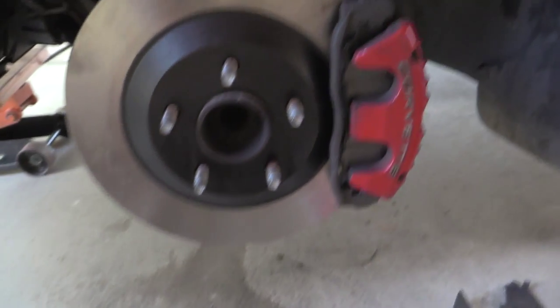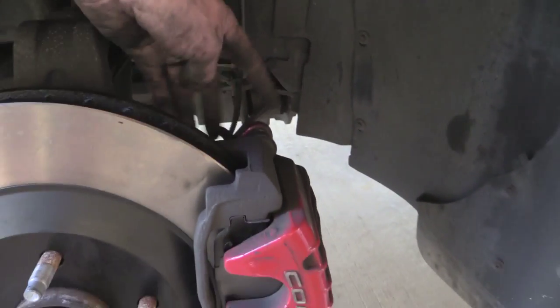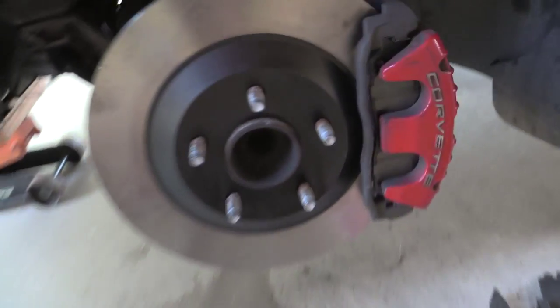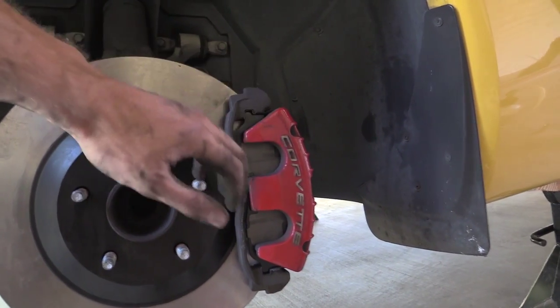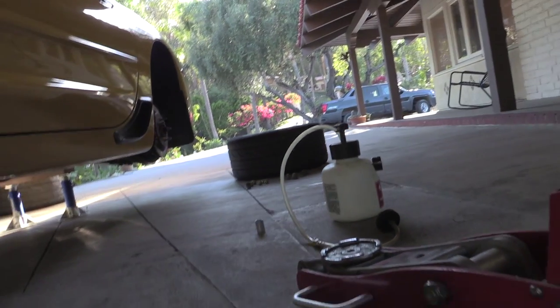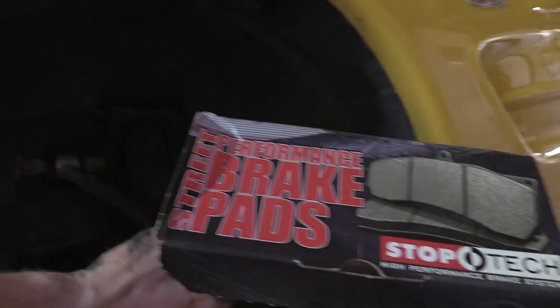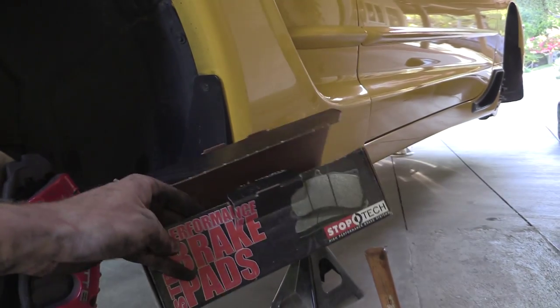So this is everything back together on the front brake caliper. This torque specification is 23 foot-pounds — that bracket was 125 foot-pounds. It's also good to use a little bit of Loctite on those bolts so that they stay in place. Some people use lube in here, but I found that on the racetrack the grease will just dry up because the temperatures with the brake pads are so high. I got these Stop-Tech street performance pads, which are a good crossover pad — I can run a few laps at the track. These are not as good as my full-on race pads, but this car is just a fun car, so this is a good compromise pad for me. Thank you for watching — let's go ahead and do the back brakes now.